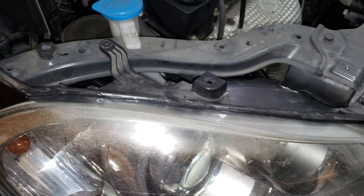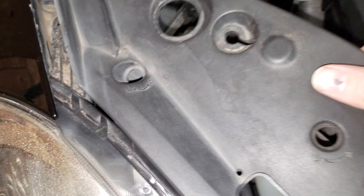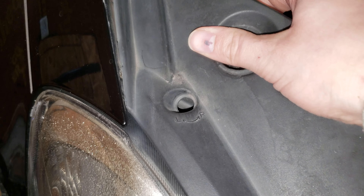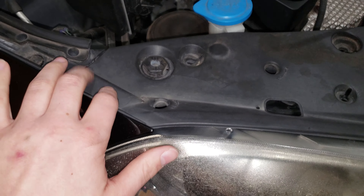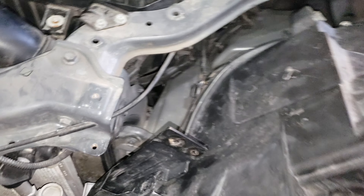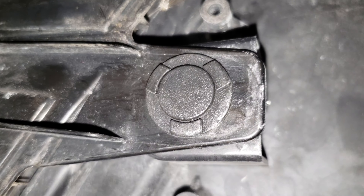H7, H7, H11. Always, before putting everything back together, turn on your brights and make sure they're both working — and they both are. There is a light humming or whining noise coming from it, but they look really good. Once you get your five 10-millimeter bolts put back into the headlight housing, it's all locked in; everything lines up. I'm going to cut the video because the other side is the exact same process. The trick to putting the bumper back on is tilting it, putting it up under the body-side fender, and everything lines up really nice.